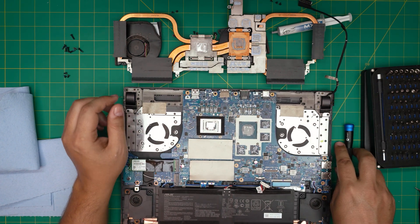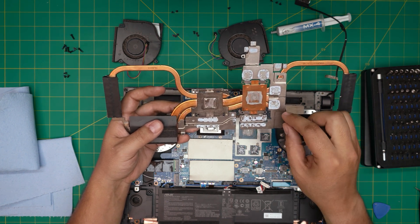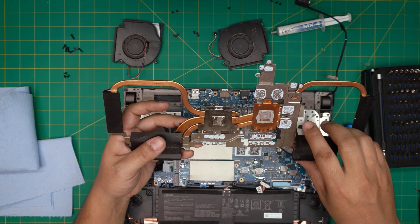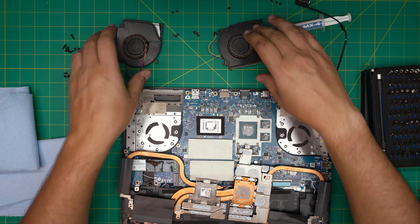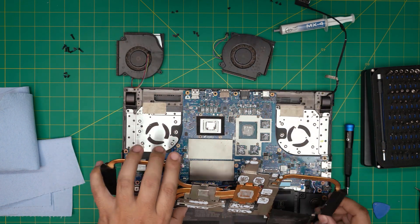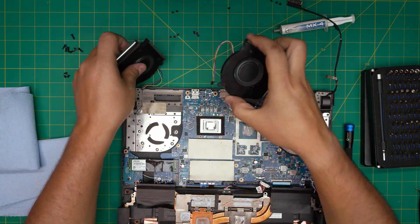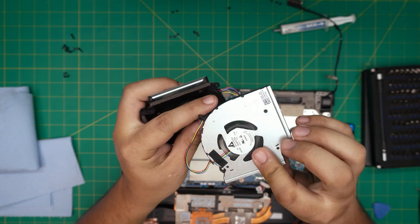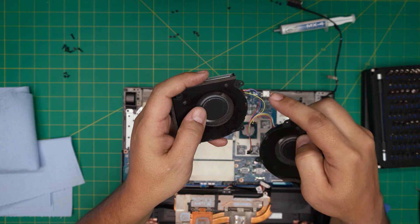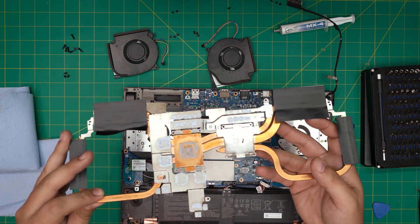For the VRAMs, I'll order some thermal putty and link it — once it arrives you can clean the old putty and apply a new dot on top. For the fans, let's take them outside and clean them with a toothbrush and some dry air — and also clean the fin stack and inside the dock system with a toothbrush. Here I've cleaned the fans — look at the difference. Use a dry toothbrush and blow dry air; don't wash them. Once the fans and heat sink fins are clean, we'll move on.